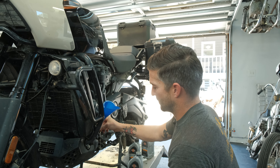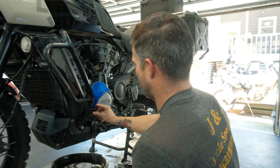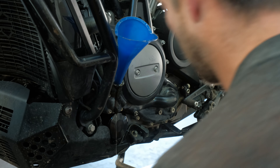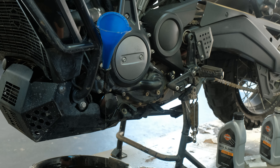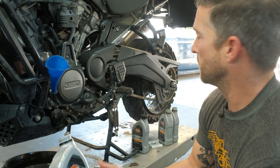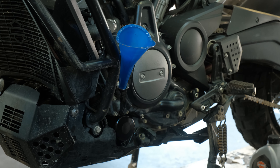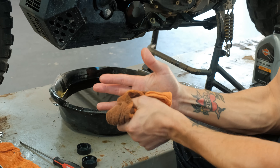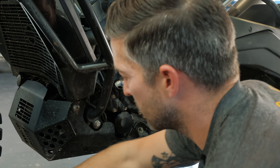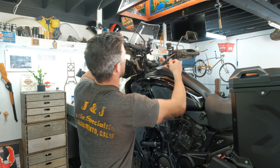That's what you don't want to happen. I was pouring the third quart in and apparently poured the first three quarts in too fast — the oil didn't seep through the engine fast enough, backed up into the fill hole, and overflowed. I'm going to need a little bit more than that last quarter quart of oil, but it's still fine to start. Lesson: give it more time, especially after the first two quarts. Fill slowly — luckily I still had the pan underneath.